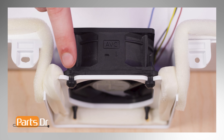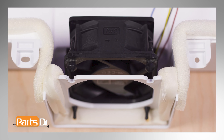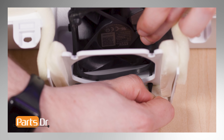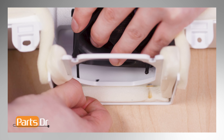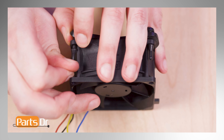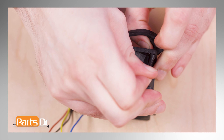Remove the fan assembly by pressing up on the grommets to release them from the retainers. Then stretch the two tabs on the bottom while pulling the fan in the opposite direction — this allows the rubber to stretch so that it becomes thin enough to pass through the holes in the evaporator housing. Remove the gasket from the fan using the same technique, stretching the tabs so that the rubber becomes thin enough to pass through.